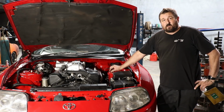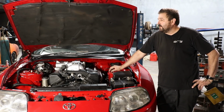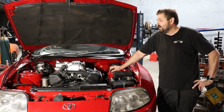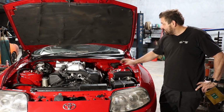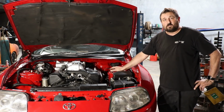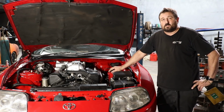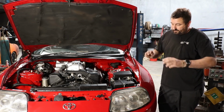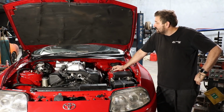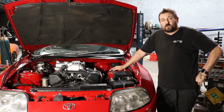Anyway, so this week I'm planning on pulling the fuel tank out. We're going to try and flat floor it. I've got a fuel cell turning up and we'll start looking at where the turbo is going to sit and how we're going to get lines to and from it. The aluminium charge pipe I think is going to have to be oval. It's going to have to be on the outside of the chassis rail, so I'm going to have to get some 1¾-inch pipe or something, cut it down the guts and weld plates in and make it into a 1¾-inch high oval pipe so it's not dragging on the ground. Anyway, we'll get it up, get the fuel tank out, and then have a look what room I've got.